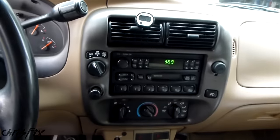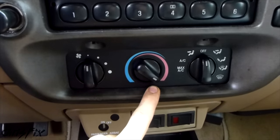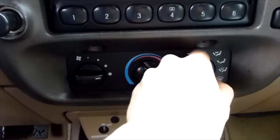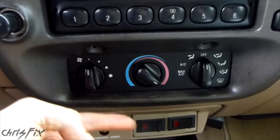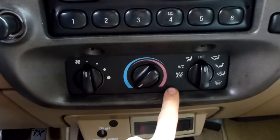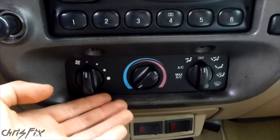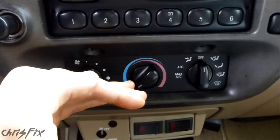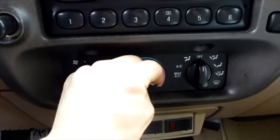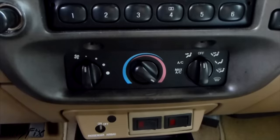Let me know how you do with your heater core flush — hopefully this video was helpful. If it was, remember to give it a thumbs up, and if you're not a subscriber, hit that subscribe button. The top tip for this video: during the summer, make sure you put your heat on once a month. Even though it's really hot out, just turn it on when you're not in the car and let it run for five minutes on high. That's going to circulate the coolant inside the heater core. If you don't turn the heat on all summer, that heater control valve never opens, the heater core never gets flushed out, stuff settles to the bottom, you create clogs, and you end up with stagnant old coolant in there — which is not good. So turn on the heat, blast it for five minutes once a month in the summer — that'll keep your heater core in tip-top shape.